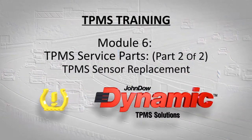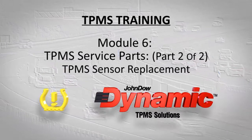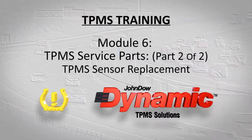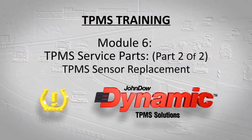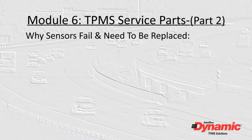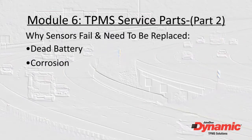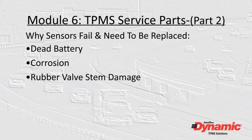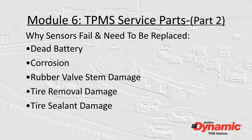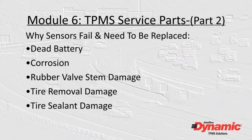This is Module 6 of the series, TPMS Service Parts Part 2, Tire Sensor Replacement. In this module, we will discuss why TPMS sensors fail and need to be replaced. The most common reasons a TPMS sensor will fail or need to be replaced include dead or failing battery, corrosion, rubber valve stem damage, tire removal damage, and tire sealant damage. Let's take a look at each of these to better understand why.